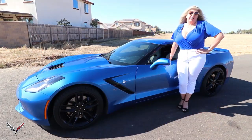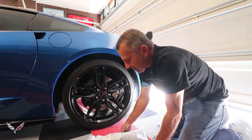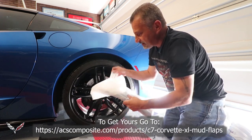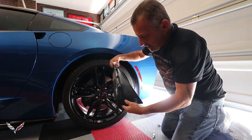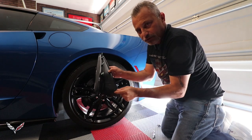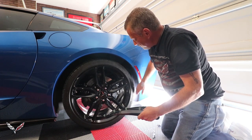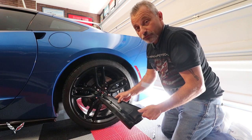I'd like to thank Jonathan over at ACS for sponsoring this episode. Now we're at the back of the car and we're going to be doing the XL rear mud flaps. You can see they've got them all nicely wrapped up. They just use snaps like I was talking about, and it also has an anchor screw. All we're going to do is take the seven millimeter screw out of the bottom, pull the old one off, snap the new one in place, and put the seven millimeter screw back in — and we're good to go.